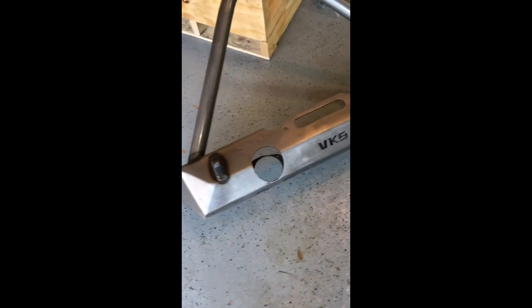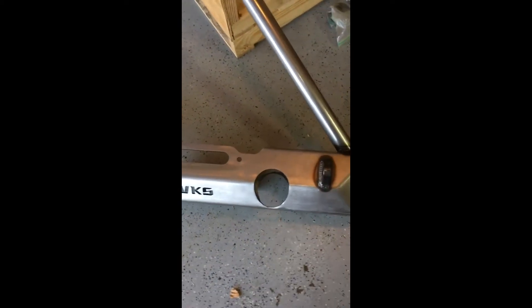I really like the two-inch bar as opposed to a lot of competitors' one-and-a-half-inch. This is two-inch — it's heavy duty. You should really check out their website, VKS Fab. I'm not trying to plug anyone — Off-Road Elements and VKS are not sponsors for me. There just weren't a lot of videos on this thing and people should know about it. The JK community alone is just huge, and this, for what it is, is a phenomenal bumper. It's kind of like a stubby bumper, but the way it flares out it's going to come to the very edge of the grille, so the grille won't be exposed. It'll be protected, but it's not going to block the wheels in case you ever decide to go with bigger tires — you'll have clearance.